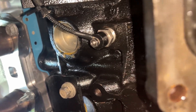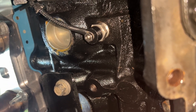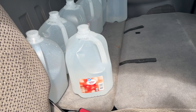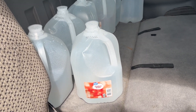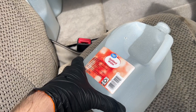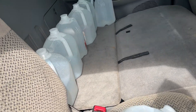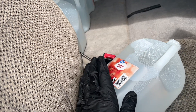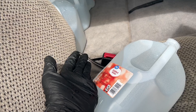There's how that looks all put together. You can see that temperature probe goes into the block and then the wire goes right on the edge of that, and then that runs up to a switch and a bunch of other stuff. Since we know this whole issue started because somebody put regular tap water in here, I went ahead and bought a bunch of jugs of distilled water. I think this truck's capacity is something like five or six gallons and I bought eight, so this will be more than enough. And if we have to drain again and refill, these are only like $1.20 each. So not too bad to do it right. Then eventually I'll put real coolant in it.